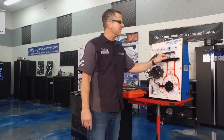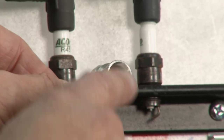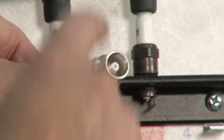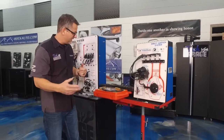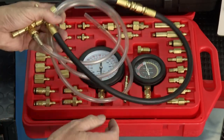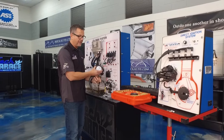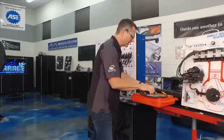When it comes to engine performance, there's a ton of specialty tools. Starting with a spark tester — it's a simple tool, but it has a predetermined gap and the coil actually has to produce enough electrical energy to jump that gap. Using a screwdriver is not a good idea; that's why we use a spark tester. For fuel systems, same thing — RockAuto.com has this whole fuel pressure gauge set with all the different adapters. Put it on there, check your fuel pressure, make sure it's all right.